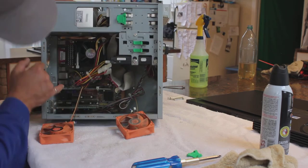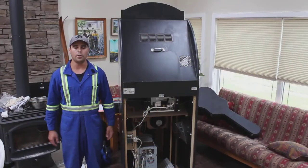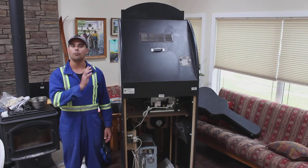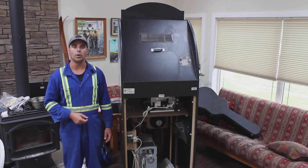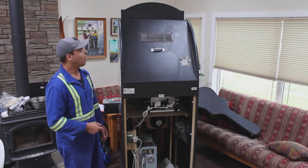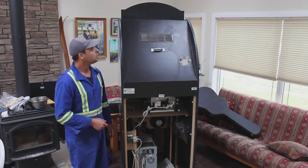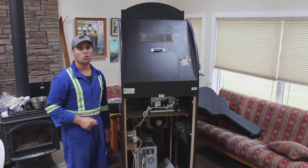We have our PC cleaned now and we need to replace the power supply. While we're waiting for that, we're going to start cleaning the exterior of the cabinet — starting from the back, doing the sides, then spinning it around to work on the front including disassembling the marquee. This thing is quite tall so you'll likely need a chair. Make sure you do it safely and don't stand on an unsteady stool. We're going to start by removing the panels on the back so we can do a thorough cleaning job.